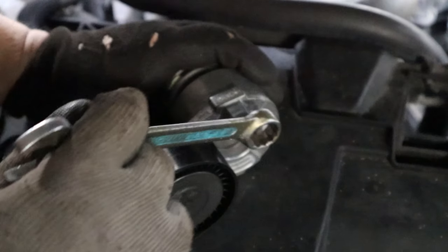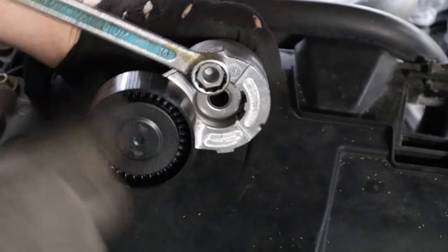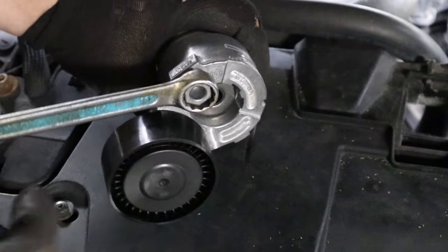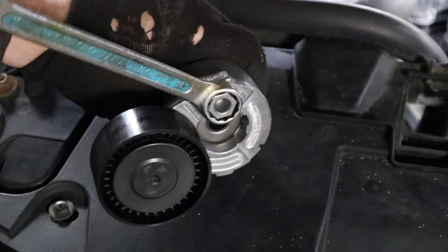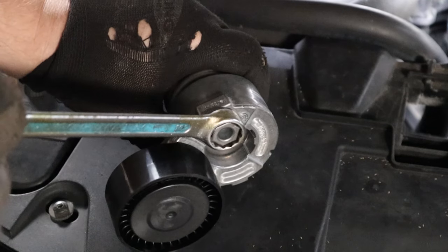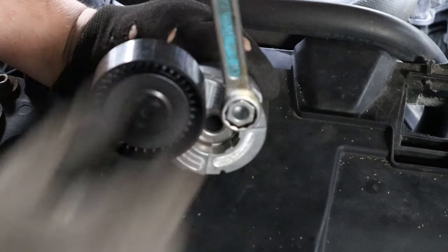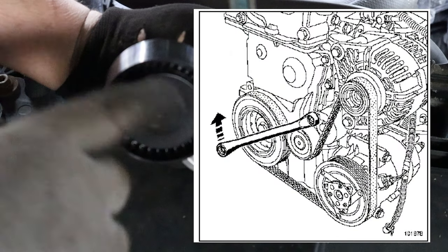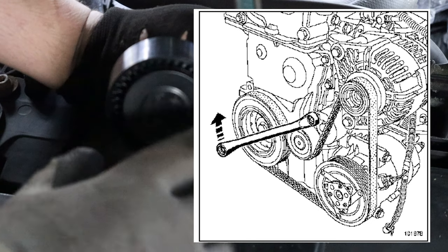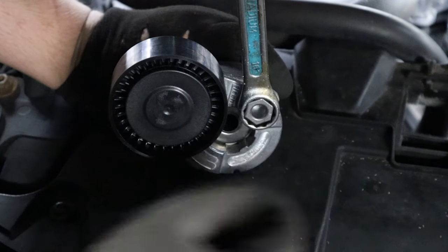I definitely need to buy some longer spanners — that will definitely help in this case. What I'm trying to show you is: if this is the front of the engine, it is now sitting something like this. What you want to do is put your spanner on it and undo the tension on the belt. This big spring right here is definitely going to fight you all the way. So put it as far as you can and then remove the belt. Just note how the routing goes for the belt — if you find a picture I'll definitely post it. Routing can be a bit different depending on what accessories you have on the car.